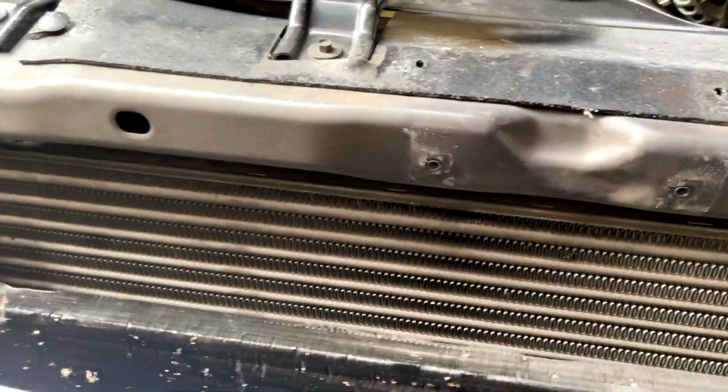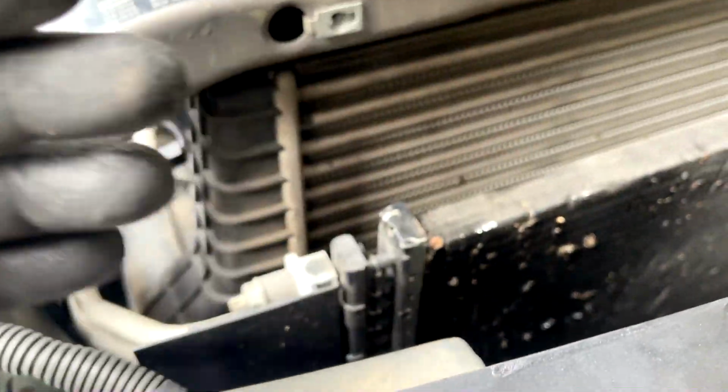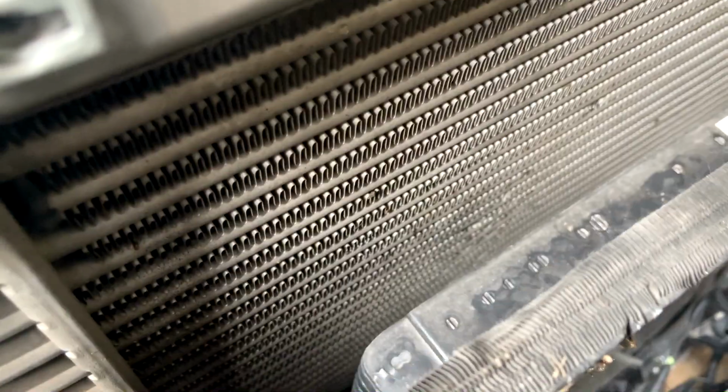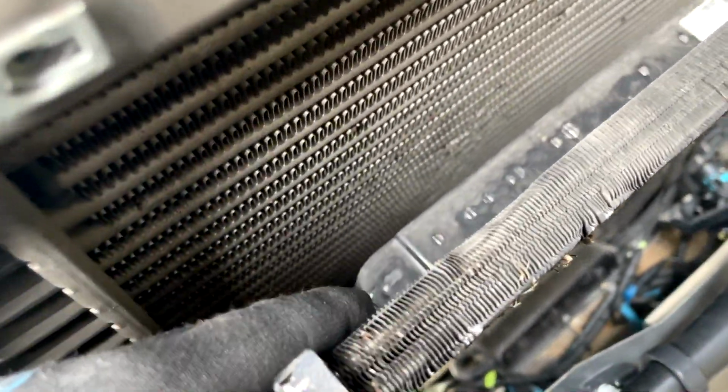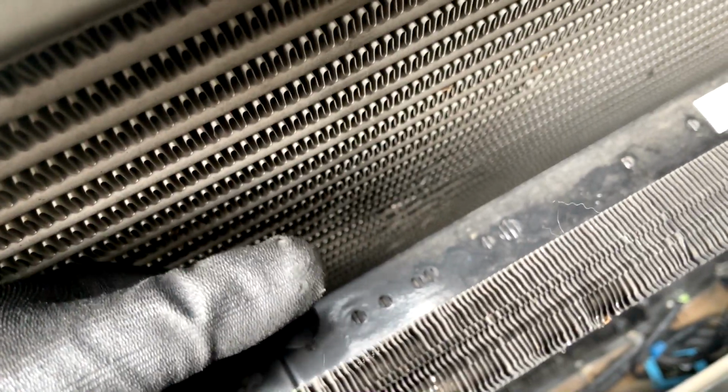All right, so now we need to go ahead and pull the charge pipes out. I got both 11 millimeter bolts undone. And what I'm going to do now is pull these out, and then the whole intercooler is going to slide forward. You're probably going to have to undo the transmission cooler down here if you have the aftermarket 6.0 upgrade. I also have a video on that on my channel if you guys are interested.